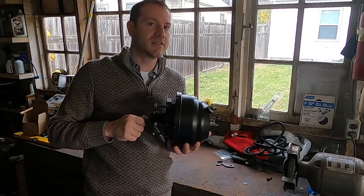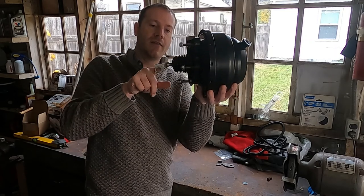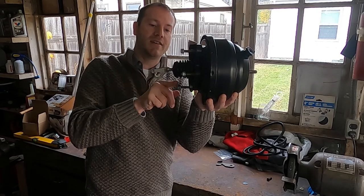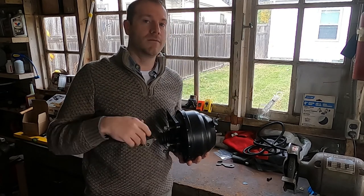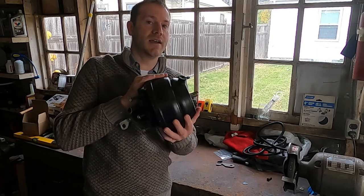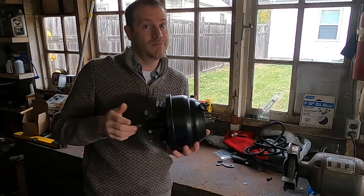If the booster isn't strong enough, this push rod pushes into the power brake booster — you've got all this boost happening — but the input shaft into the master cylinder doesn't move, or doesn't move enough. Eventually the push rod comes into contact with that input shaft, and essentially you have manual brakes with just a little bit of boost. That's what I was getting. In fact, I did lock up the brakes at one point in a panic stop, and what happened was this push rod literally got bent 90 degrees down. The back brakes were connected and working, but the booster was not supplying nearly enough brake assist.